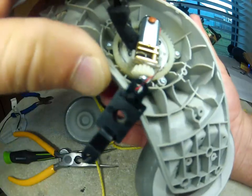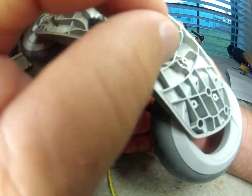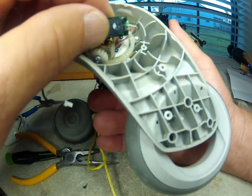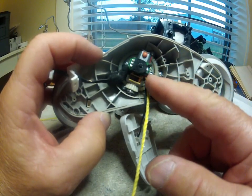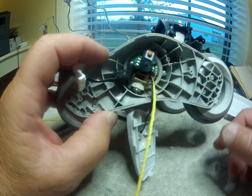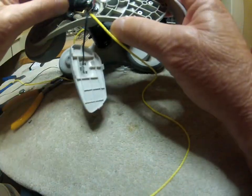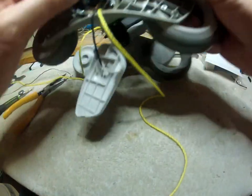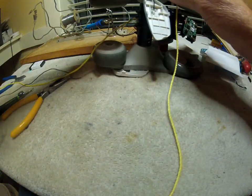Motor mount screws in. Next is the position sensor. Tab on one side, tab to the other side — the tab around the part of the sensor goes toward the front trailing wheel. Position sensor is set up. I'm going to preset the flat port towards the rotating or floating front wheel. This bracket orientates the hip position; it has a flat side that faces forward. Flat side to flat side — it sets and rests in place. That's more explaining than it needs, but just so you know.